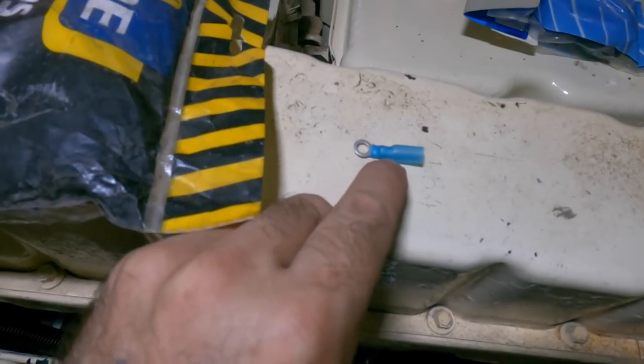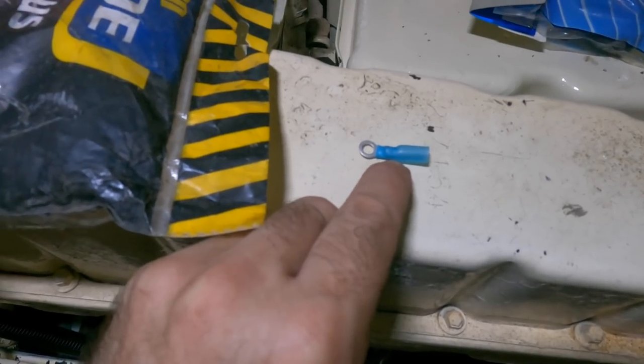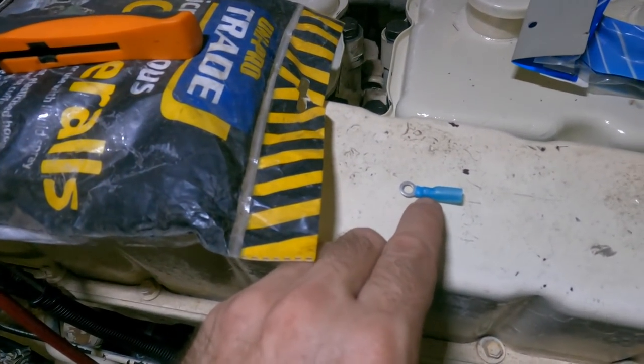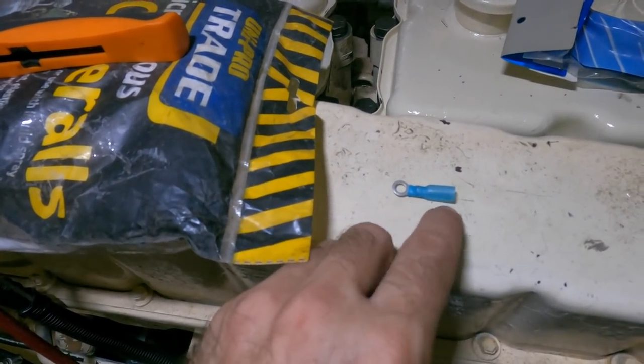The reason for square jaws is that if you crimp and end up breaking or piercing through the heat shrink, you essentially create a hole that water can wick into. By using crimpers with square or rectangle ends, you flatten it without bursting through the resin infused heat shrink.